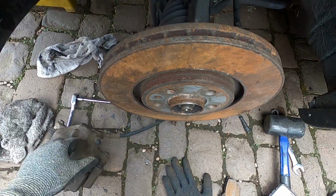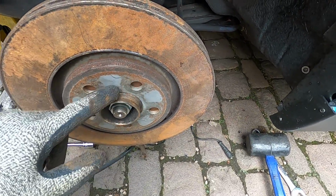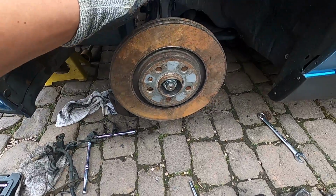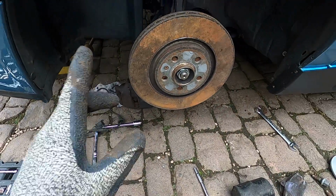and we'll be able to fit the 280mm rotor. I think it's just the fact that we're trying to use this GTI 5x100 rotor here. I think that's the issue. So cool, now that I know that this caliper is gonna work properly, and once I have the proper G60 rotor, this will also work. We are good to go here. So now I'm gonna go ahead and put the car back together, put it back in the garage. We're gonna head to the BX and hopefully try and find the color that I wanna paint these things.